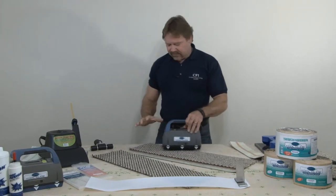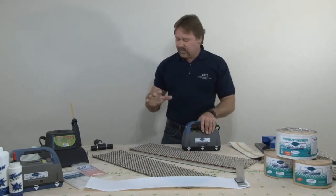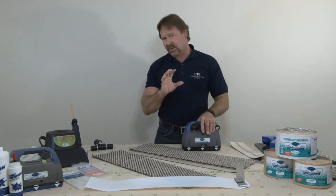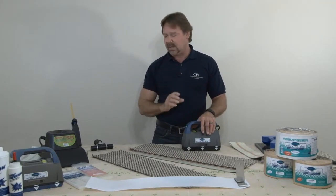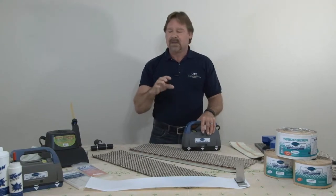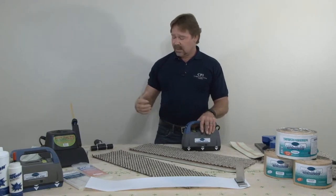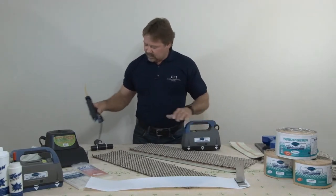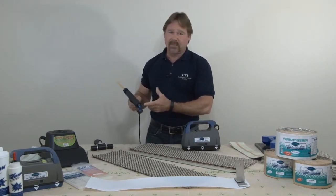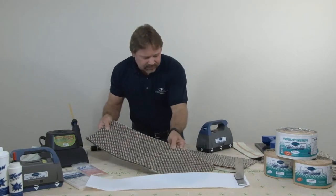Let's put this one together. I've already got the tape under and sealed it with thermoplastic — I want to do a whole section just on seam sealing, which is on this DVD, covering pros and cons of liquid products versus thermoplastic products, meaning your glue gun. What I used here was a Trax gun with the fusion tip; it works great at applying it to the edge.